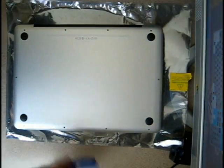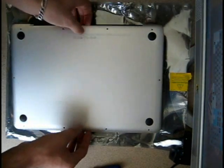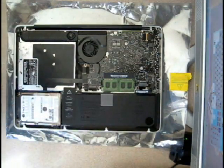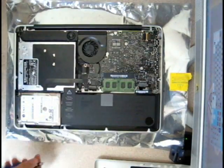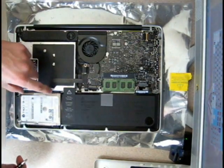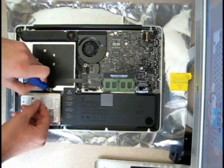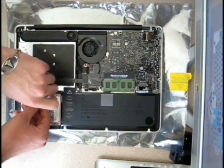For the purpose of this video, I've already removed all the screws. Take out the back panel to expose the internals of the MacBook. You have two black screws which you must remove with the 00 Phillips screwdriver, so I'm just going to go ahead and remove those.